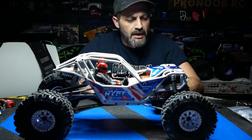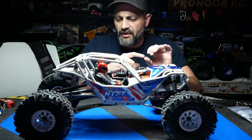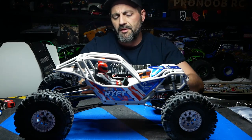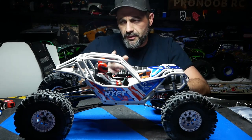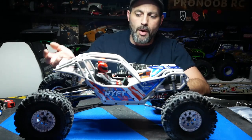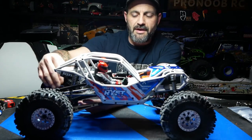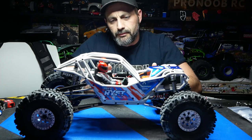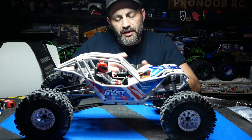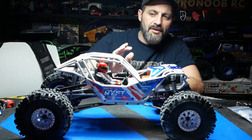When we did that without the grease — just the 2-million-weight silicone stuff — it would run a few revolutions and then completely bind up and the thing would just twist in my hand and almost cut your hand open. That was a problem we wanted to deal with before putting it together. Because if you go out with that and get one wheel bound up and this thing wants to spin at a billion miles an hour, your diff is just going to shatter, blow apart. Guys are going to blame it on weak gears, which we've seen in a lot of videos. So with a little bit of time, you can make these things work fantastic.